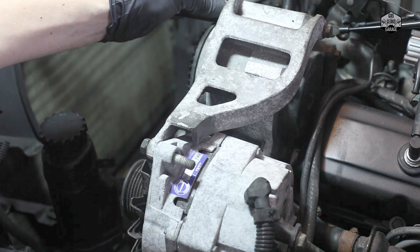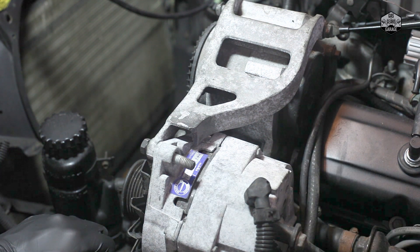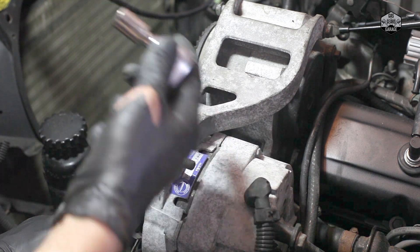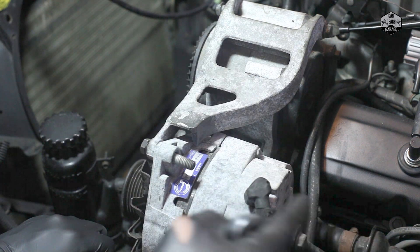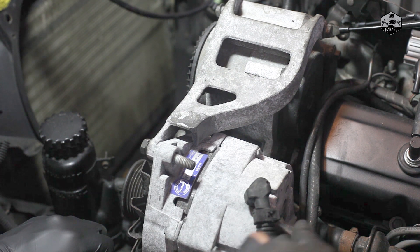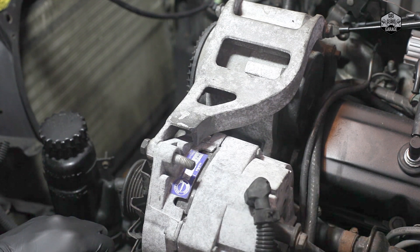The only other tricky one is going to be the one down here at the alternator — there's a support one there. I suggest using a one-and-a-half inch extension to get to it. You are going to have to remove the support bracket that goes to the header, which is another alternator support bracket. This one will have to come off because you need to turn it, as well as use an open wrench for the hex at the bottom.